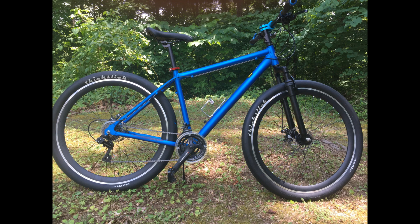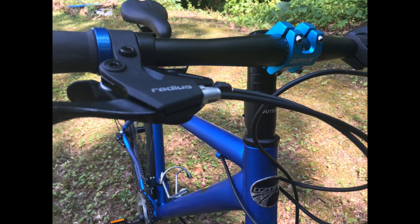So I ended up purchasing a quill adapter so I could use a standard stem on it — that helped a lot. Put some better handlebars on it — that helped a lot. With the shifters, you'd be better off with pull-choke cables from a lawnmower than shifting with those horrible things. So I also went and got some Shimano Clickfires for them, and that helped tremendously.